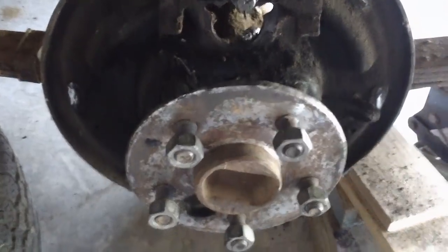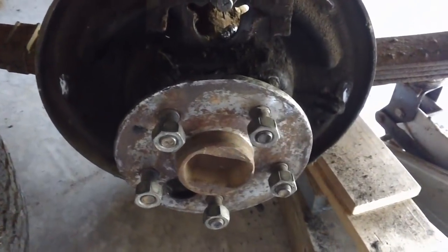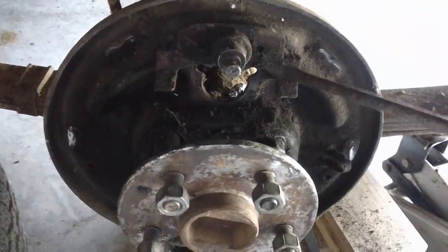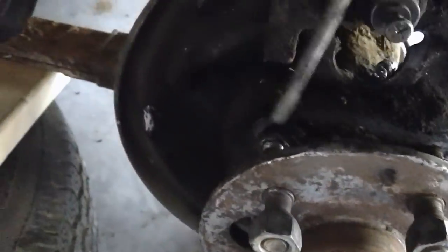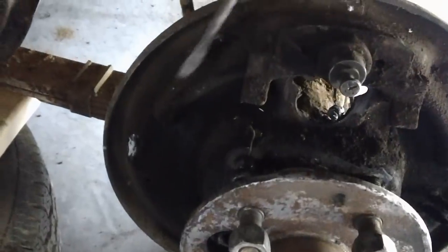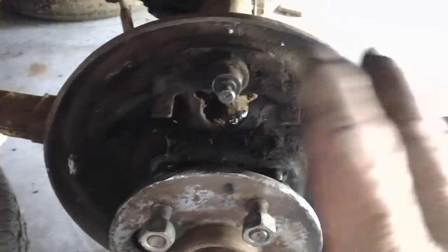There's a tool - sort of like a wheel puller type of affair - to pull it out, which we may have to resort to. This backing plate is a mess - it's horrible. I don't like it, I want it clean and squared away. Once the four nuts are off, I stuck a screwdriver behind this plate and it will move back and forth. On those nuts, you've got to get that off of there if you want the axle to come out, because it'll wedge if you don't. I only need to get the axle out in order to get the plate off. I know Brendan's sitting out there saying he doesn't believe I'm doing this - but I am a paranoid kind of guy. We're going to make it look really purty.